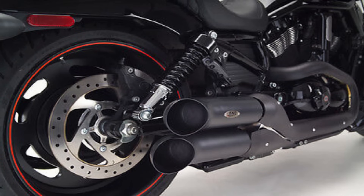The first thing you could do with your V-Rod is go ahead and put a set of slip-ons on it. Just adding a set of slip-ons without a tune — you keep your stock air filter in there — yeah, you'll get some good sound out of it, but that's really not going to give you any performance gains. And chances are you're likely going to have some decel popping. When you're decelerating and letting off the throttle, you're going to have that pop, pop, pop out the back. That can get extremely annoying after a while.